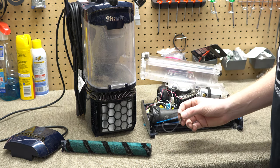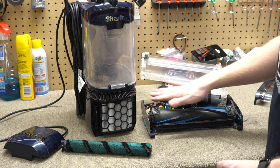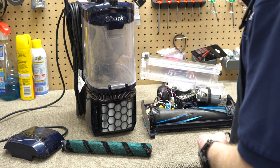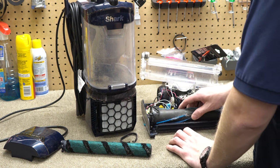There's a broken belt. Now this is a Kevlar-reinforced belt — this is not designed to break. There's plenty of circuitry that should stop this belt and stop this unit before this ever happened, but it seems to be ineffective on Shark. That's probably a result of cheap manufacturing.